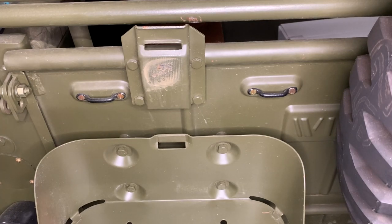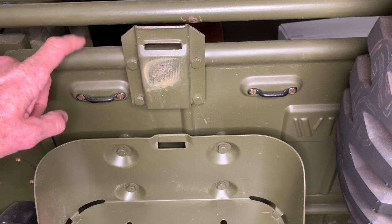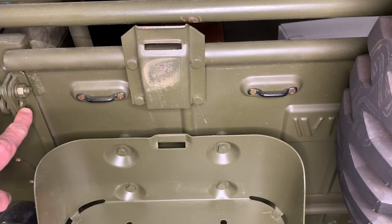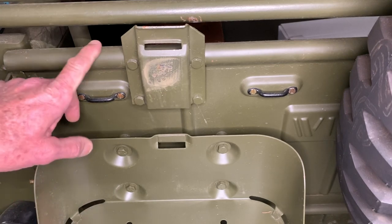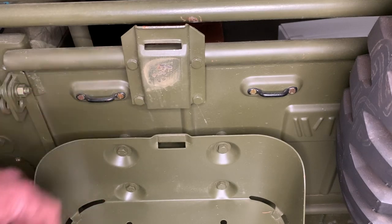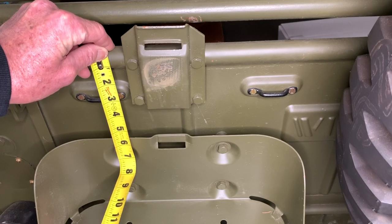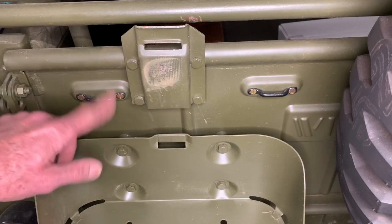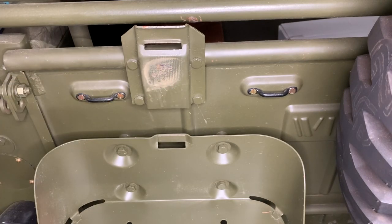Before you install these, there's something you need to check. On the CJ2A that I made look like a militarized jeep, we've got the tailgate bolted shut like an M38. The measurement you need: from the top of this rail you need to be about five and a half inches to the top of your jerry can. I went out back and checked the '43 MB and it's the same distance, so that's going to be important.